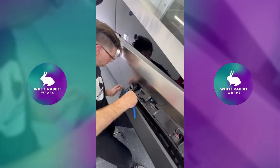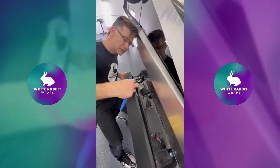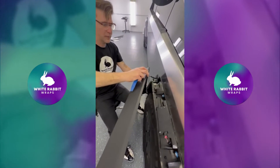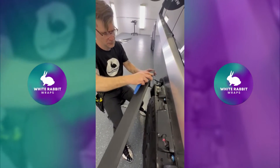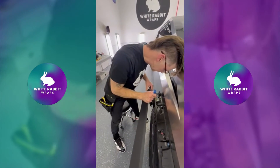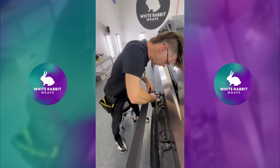There's a clip behind the camera. Tesla didn't really leave us enough wire, but you can see the camera wire back there is just a little wire plug. We'll take this off and disconnect it — it's a little pin connector just like any other connector.